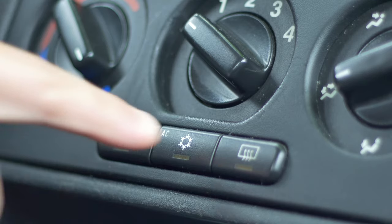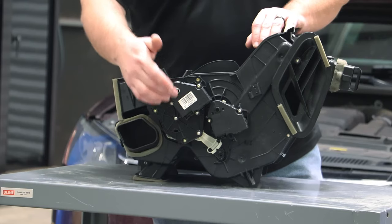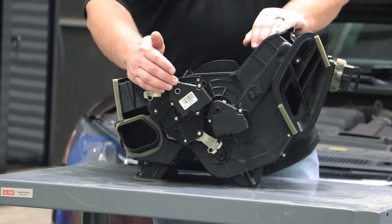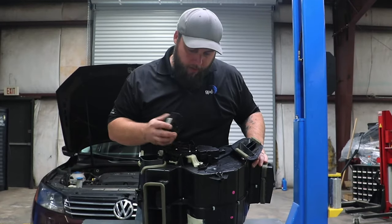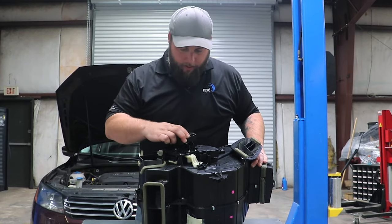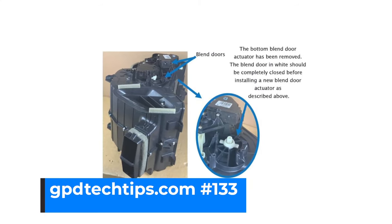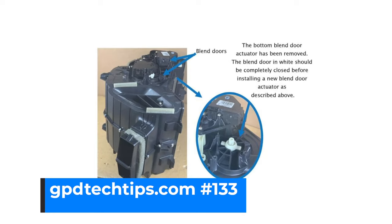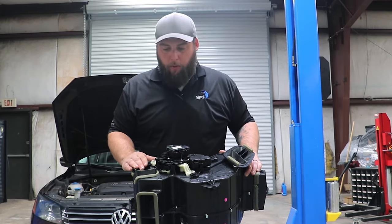A lot of times you're not getting air out of the desired vent or you're not getting the desired air temperature. Sometimes you may hear a clicking noise on the inside — a lot of times that's because the electrical and mechanical components inside the actuator have failed, so they're getting the signal but can't make the connection needed to open and close the blend door or mode door. When removing the old actuator, make sure none of the door positions change before you put the new one on, otherwise your door will be in the wrong position and you won't get the desired temperature or mode.